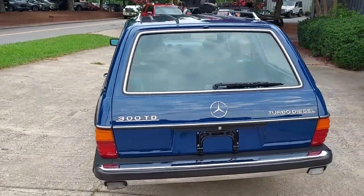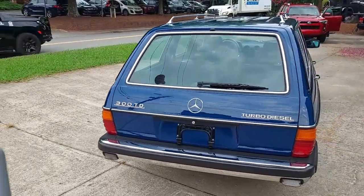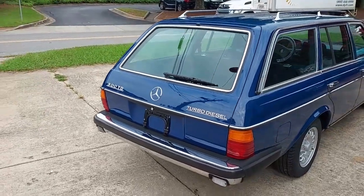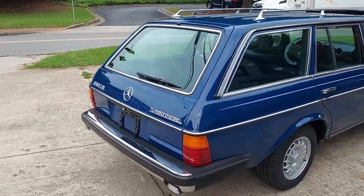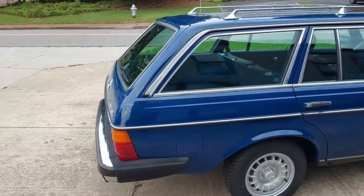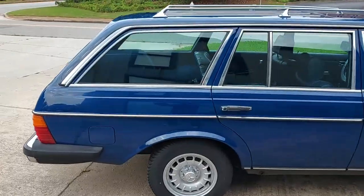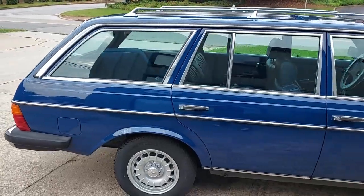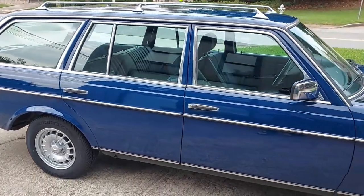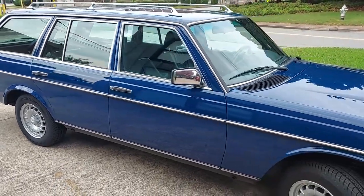New engine mounts ordered from the Mercedes Classic Center, new front wheel bearings and seals, new Bilstein shocks, new Mercedes SLS accumulators, new Mercedes SLS leveling valve, flushed the SLS fluid and put in a new filter, new flexible transmission cooler hoses. The original axles were rebuilt and booted by CV Source, new AC compressor, new AC receiver dryer, new